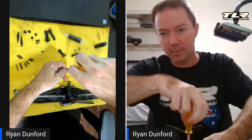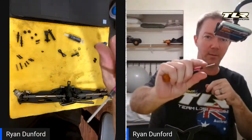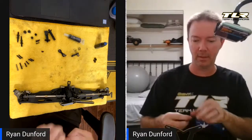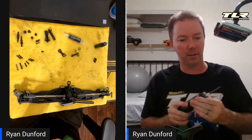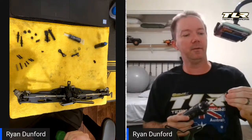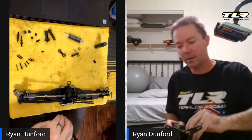The front uses these collars on the front. I'm just going to put the set screws in over here really quick so those are ready. The only problem with front sway bars is there's just a ton of set screws everywhere. For these collars, I start one and stick it on here for now — not super tight, just snug enough not to fall off — and then I'll center it on the car. What I usually do is stick it through and put it in place. For these blocks there's one side that doesn't have anything and one side that does — the side that doesn't have anything I always put up.